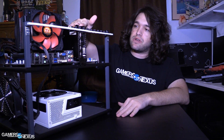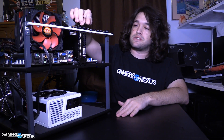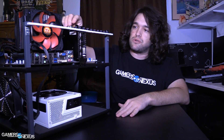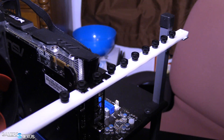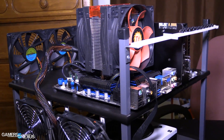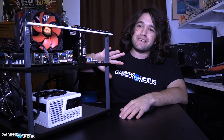All that matters here is that we have very easy access to the video cards. You can see it supports up to four-way SLI as long as the motherboard does. We can easily unscrew these nylon screws — obviously two per card or one per expansion slot — then take the card out and drop the next one in. This is done for something like 10 video card configurations, so this can save up to a couple minutes per card by eliminating the requirement of opening up a case and getting down on the floor pulling the card out in the dark. It takes about 30 seconds to swap a card.